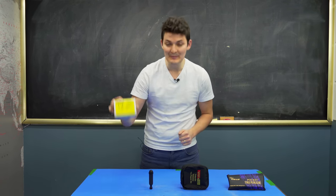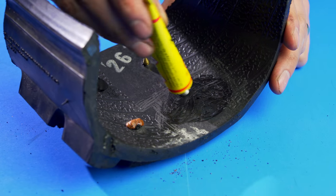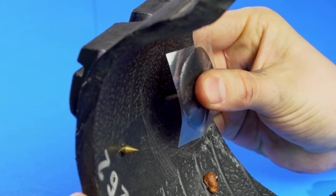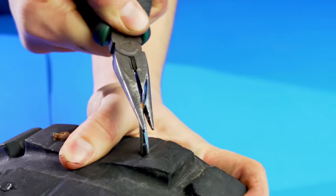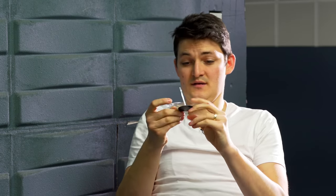Finally, we have our internal patch plug — the only fix considered permanent in this industry. You have to dismount the tire for installation, so it ain't a roadside quickie. We add rubber cement, push the quill through the puncture, allowing the patch to vulcanize in place, remove the metal sheath, and cut the excess plug. So the patch is airtight and the plug is airtight — there's a level of redundancy that makes this the only safe option. All the others are temporary.